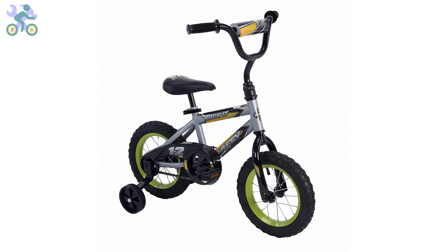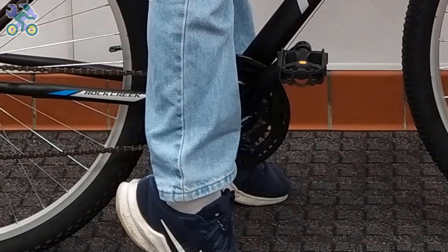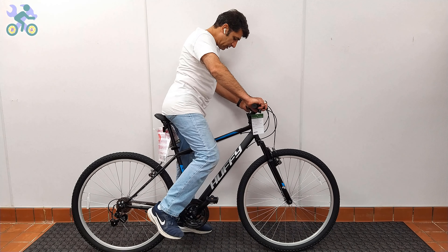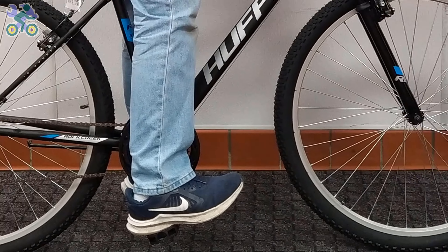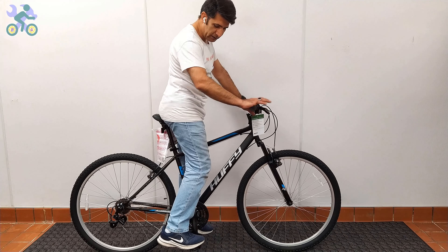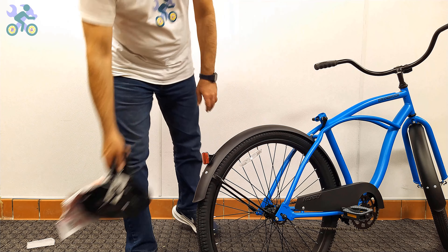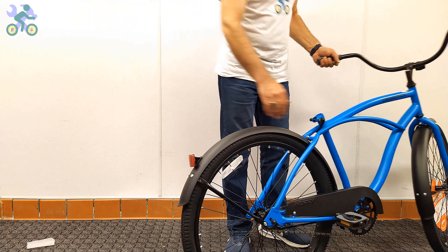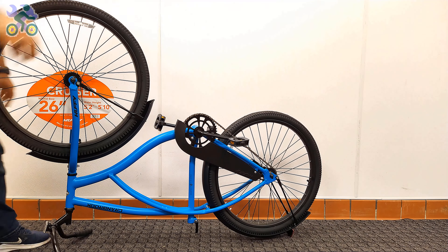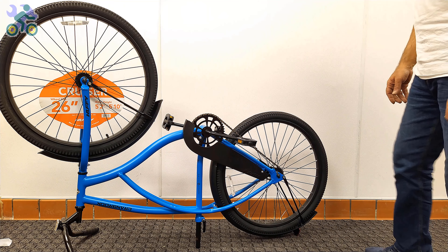For bikes with training wheels, it's enough for the child's toes to touch the pedals and be able to turn them. For bikes without training wheels, the seat height is appropriate if the toes can touch the floor while sitting, or if one foot is firmly on the ground while the heel of the other foot is flat on the pedal and the leg is slightly bent. If the seat post falls into the seat tube, turn the bike upside down and gently tap the body to remove it. Another solution is to install the seat post alone first and then attach the seat.